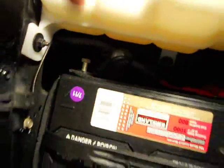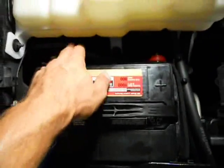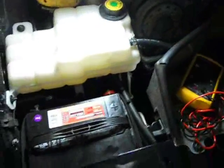On these side-post GMs, it's a little bit tricky to get anything on your battery because the side post is threaded in. So I just use a bolt that fits in there, thread it in, move my negative cable, and put an alligator clip on my voltmeter. That basically just lets you hold the probe to it, which frees you up a little bit.